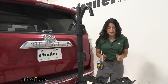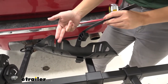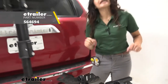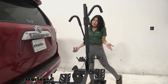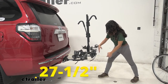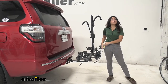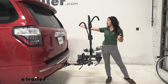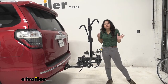Now that our bike is off we can take a closer look at the bike rack itself. We have these metal wheel cradles as well as wheel straps. The maximum tire width we can accommodate is up to three inches — you can get an adapter if you do have fat bikes, so make sure you know your own tire width. Measuring from our bumper to the furthest point, it sits at 27 and a half inches, which is actually on the compact and smaller side for two bike platform racks on the 4Runner. That's important to know when backing into a garage or parking in a tight spot, especially with a larger vehicle.